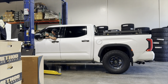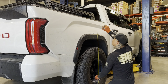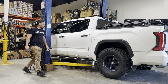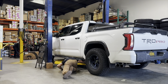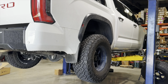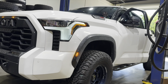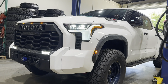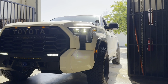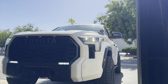Next up, we have a white Tundra TRD Pro that's going with a Westcott Designs lift kit to retain the factory TRD Pro Fox suspension. The Westcott Designs lift kit for the Tundra TRD Pro consists of the front preload collar and top strut spacer, along with a bump stop spacer in the front end. For the rear, it comes with a coil spacer and a spacer for the rear shocks. The Westcott Designs lift kit has been installed and we're bringing this one out for a quick test drive. Here at 88 Rotors, we stock the full lineup of third generation Westcott Design lift kits for all trims and models, including the TRD Pro.